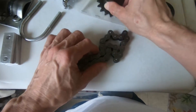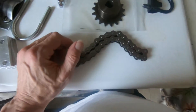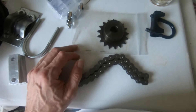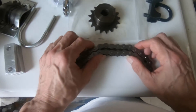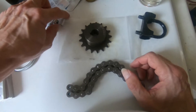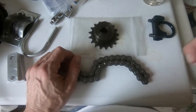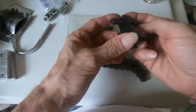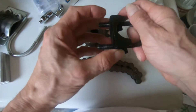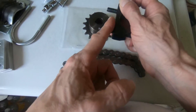I spent some time on forums trying to see how other people had dealt with this situation. One guy got a smaller tooth gear — he went with a 14-tooth gear. What I did was watch some videos of other mongoose builds, including one of the best builds I've seen, which I'll link in the description. I noticed that on his clamps, between the clamp and the shift kit motor mount, he had what looked like a spacer.